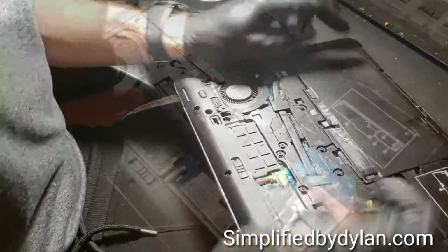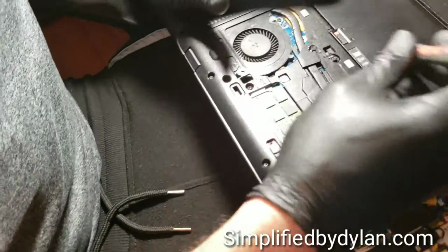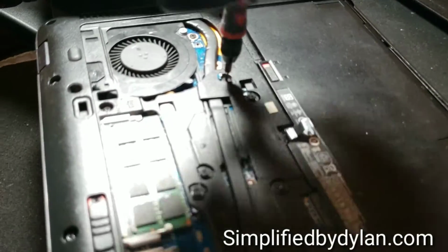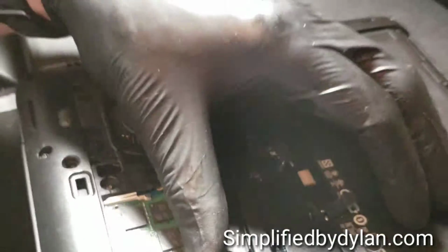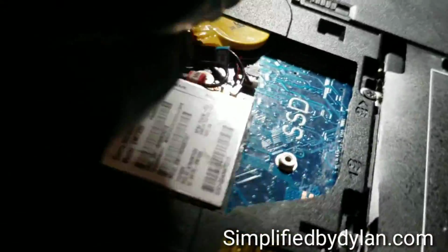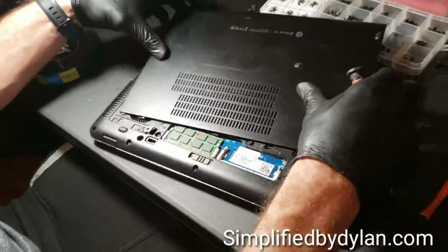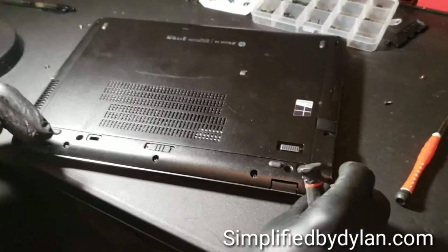And when we flip it over, now we can actually screw the keyboard in. There's those 2 screws. It has the keyboard indicator or icon on them. The third one is only for opening it. There's actually no screw on that one, so you tighten them up. On the second one, sometimes you may have to open that computer back up and actually hold the keyboard and the computer at the same time and screw it together. But everything should go on real smooth the first time if you've pressed it down correctly and you have it shut. So we're now just going to slap it back together.